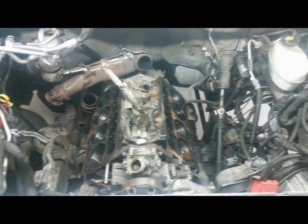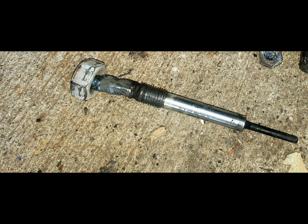This is my experience and my method. If you can get an easy-out in there — like if the center electrode is missing — I think it's worth giving a shot. But if the electrode is in there, the welding method is by far the best, because you're also putting additional heat in, and as we all know aluminum and steel don't expand at the same rate, so that helps fracture the glow plug free.